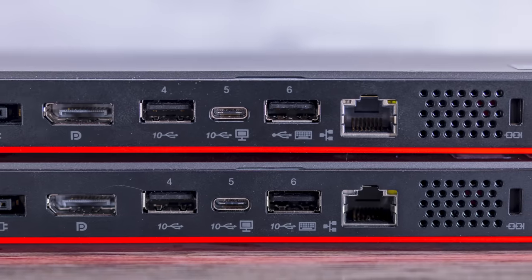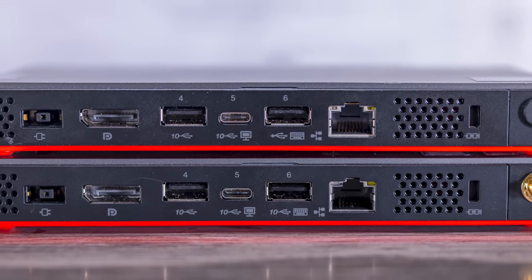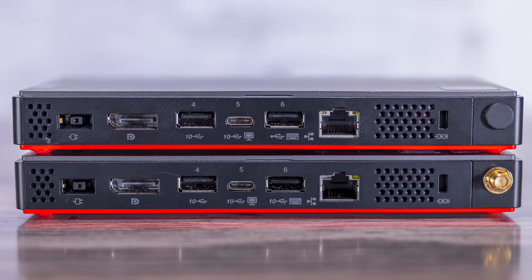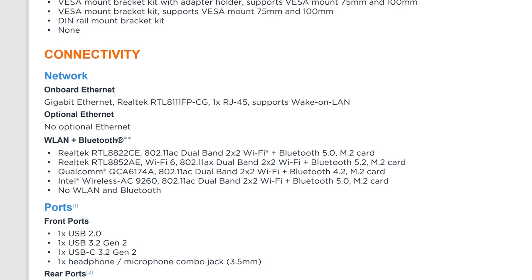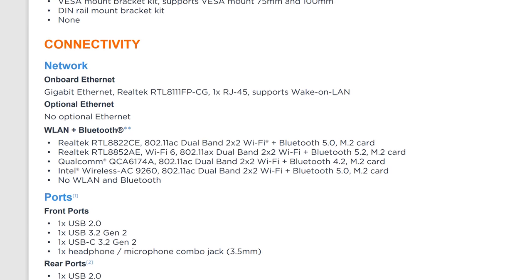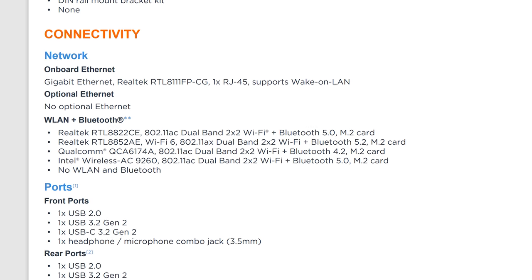Comparing to the M90N Nano, the Intel version has a USB 10 gigabit Gen 2 port where the M75N has a USB 2 port on the back — that's a second area where the Intel version wins. The M90N also includes Wi-Fi, which was a configurable option on the M75N. The available Wi-Fi options on the M75N weren't great — the Qualcomm solution only had Bluetooth 4 rather than Bluetooth 5, so I'd skip the Qualcomm AC Wi-Fi.